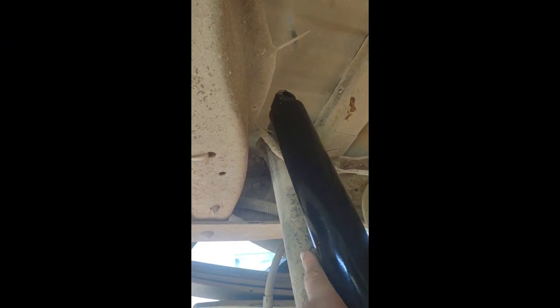This is a two-wheel drive F350, and I got the shocks that were for four-wheel drive because, as you can see, I put a three-inch lift on this truck with that block right there. Obviously this does extend enough, but I'd rather just be safe than sorry. Here is the one for the four-wheel drive truck — as you can see, that lines up even with the mounting nut up there.